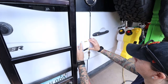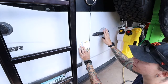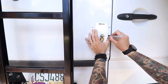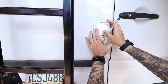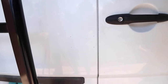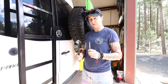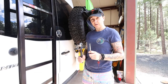We're going to position ours on the driver side door because our handle is on the passenger side, and this is what we're trying to keep from opening. We're going to put it a little bit below the handle. I'm going to take an extra step and just do a little tap into the sheet metal so it's easier to get the drill bit started.